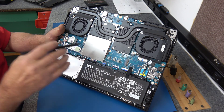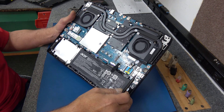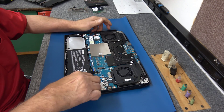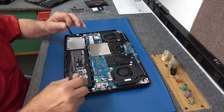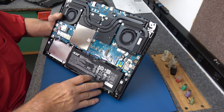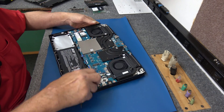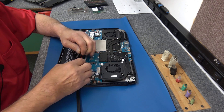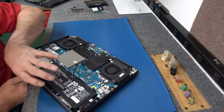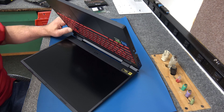Our RAM slots are under this shield right here. I'm not going to take it off until I disconnect the battery, because if you happen to drop that onto the motherboard — yikes. Let me disconnect the battery. I'm going to get rid of the little piece of tape right here. These are pretty easy to unplug, just got to take your time. Make sure you guys remind me to put that tape back on. This battery connector slides back out of the slot — just be gentle. After doing that, I still like to open it up carefully and hit the power button a few times to get any residual juice floating around in the circuits.